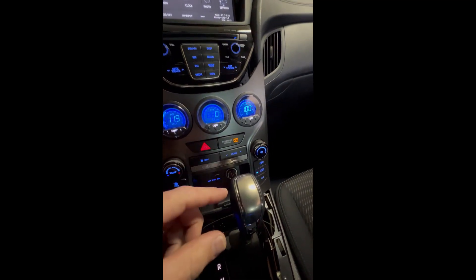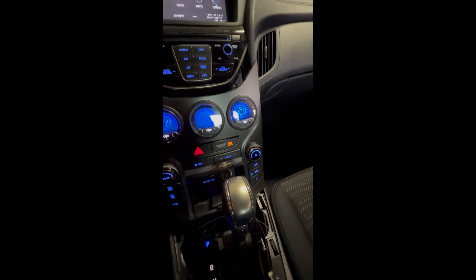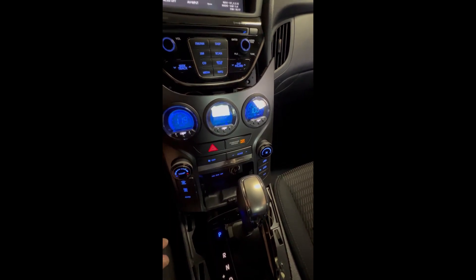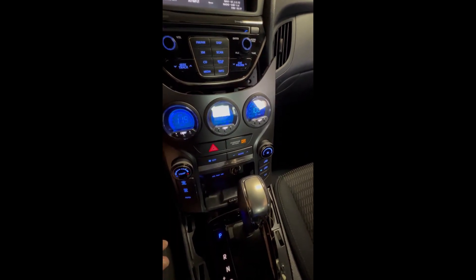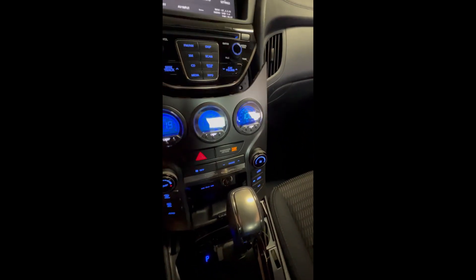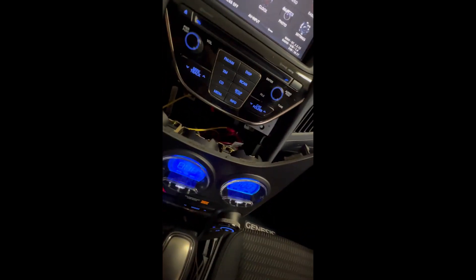Since it's smaller, you can just get an adapter — I'll show you in a minute. But after you install that, the ECU no longer has the original sensor if you put it in the place of the stock sensor, and so your check engine light comes on. That's a problem. So I had to go back and reinstall the original gauges — put the original gauges back in and tuck them back inside. That's why they're all down here.